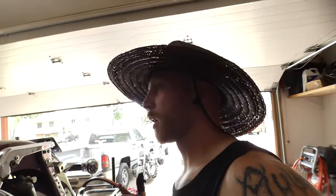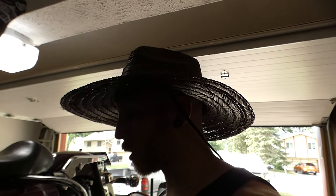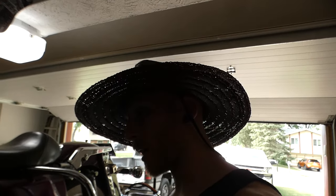So I fired the bike up, and I could hear something on the primary side making a noise that it shouldn't be making. So I opened it up to see what was happening. What you're about to see is me progressing on grinding this thing down, not the damage that was done, but that variable pressure plate was hitting up on the lip. This derby cover that we bought has the O-ring style lip inside, so you can run the rubber O-ring. The old one did not. Well, it's hitting on that lip. It's not meant to clear it.